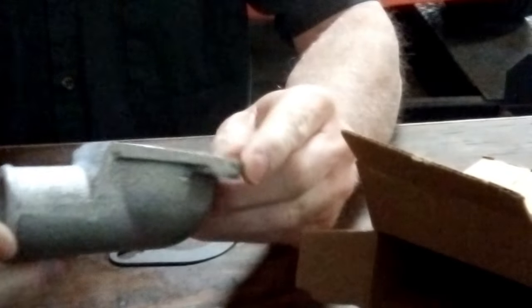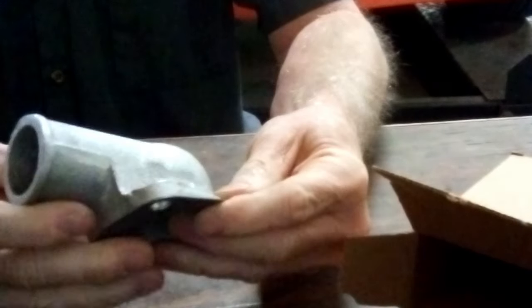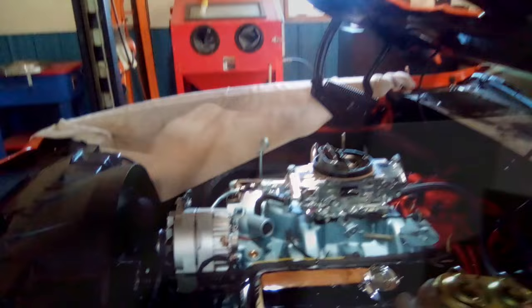I went ahead and ordered my new water neck for my Firebird from my local parts store. I'm hoping it looks nicer than the one that's on the car, but we won't know until I pull it off. There are some machine marks in it but they are smooth — there's no pitting. All I have to do is get this painted up. It even came with a gasket — it's a huge gasket but it does cover. I'll get the old one pulled off, get this one painted up and ready to go, and hopefully that'll fix that little water leak.